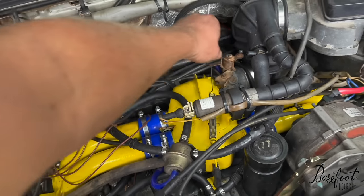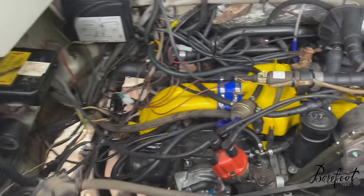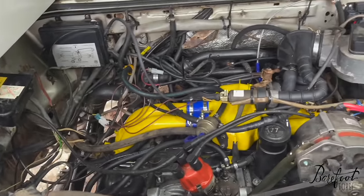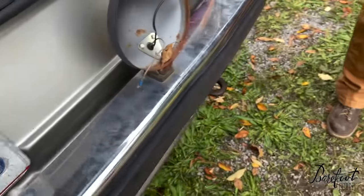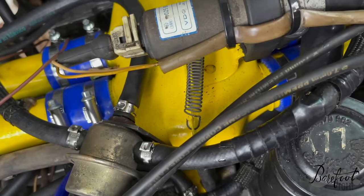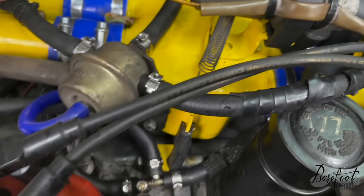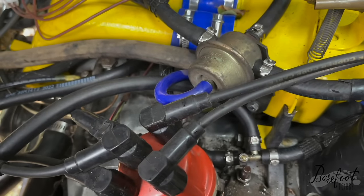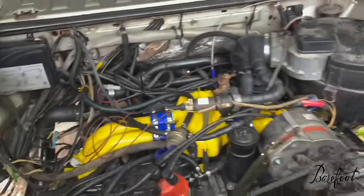Okay. Yeah, we've got vacuum leak type issues. I give it throttle and she bogs. It's still blowing coolant out the muffler. That didn't want to idle, so that's an odd thing. The oil pressure system, we just attached the two wires together. Fire it up. Let's see if that shuts it up.